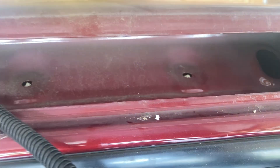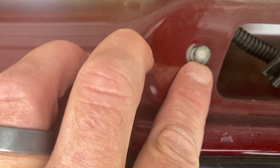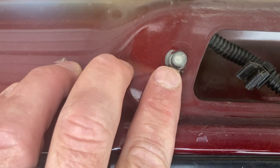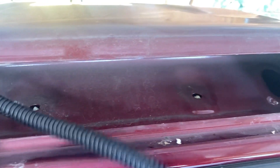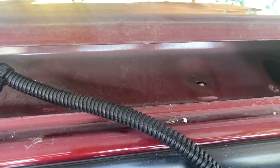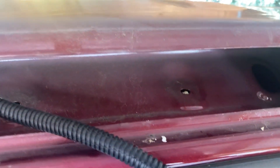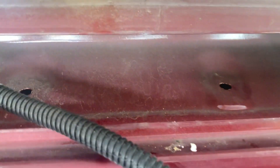With the light removed — and if your light didn't blow out in a car wash, just break it off, because it's held on with these studs that are just slip-fit kind of things. That's what broke off and allowed the light to come out in the car wash. But with the hole here, if your light didn't blow out, just pry the light off to get access, and then push down on these plastic tabs to release the headliner.